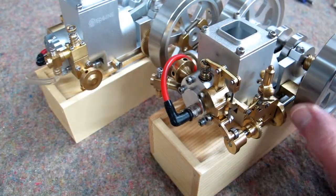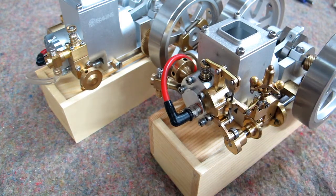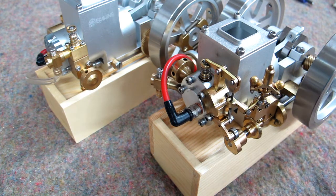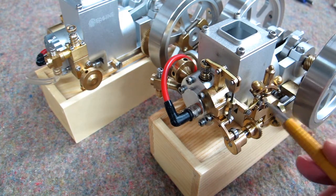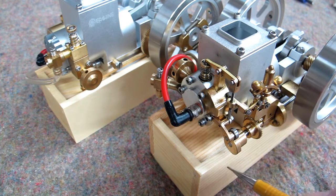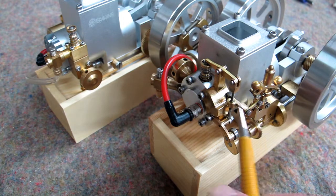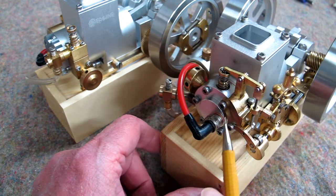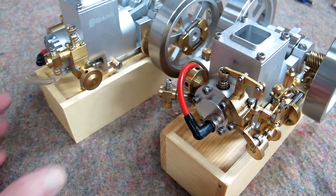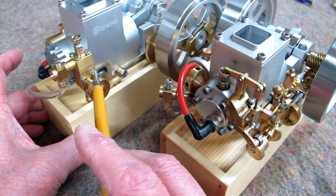The M92 with its flying ball governor and all the linkage is a very interesting engine that runs quite well — I like it. But there is a certain frailty about all those small little parts, and that has been eliminated over here. This is fun to look at, fairly easy to work on, and comes off and goes back on in alignment quite easily. That complexity has been eliminated — this is much simpler.